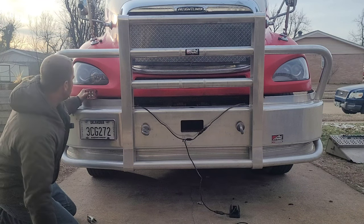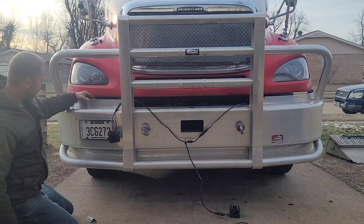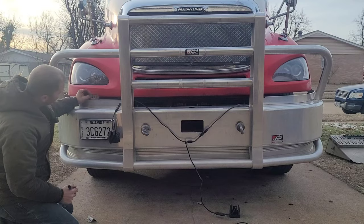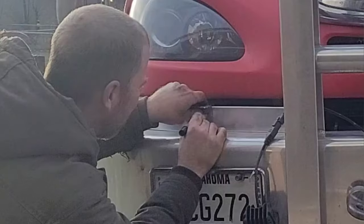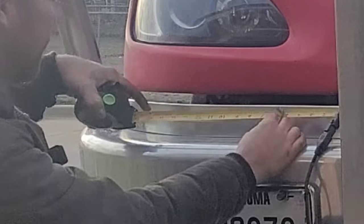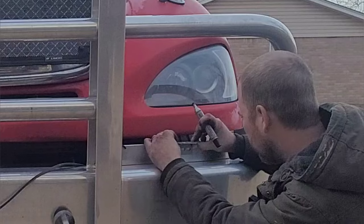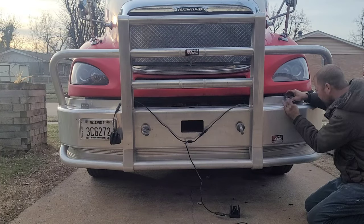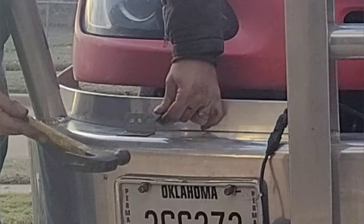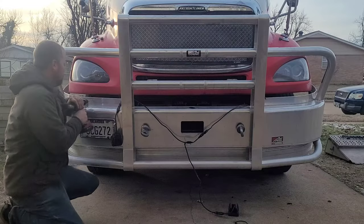Let's figure out where we want to put these, making sure they're even on both sides. This goes behind the bumper — yeah, that looks good. It's a little hard to figure out where to drill when the piece is behind the bumper, so we'll mark it on the edge. We'll measure 11 inches, mark it on top of the bumper, line it up, and mark one hole there and one hole there. We'll use a punch to put little divots in so we can get the holes started.